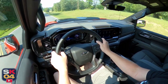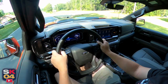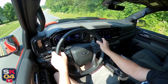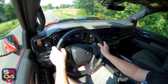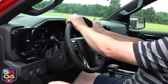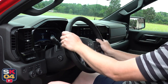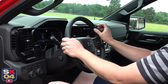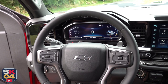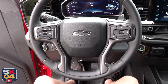The enhanced front and rear suspensions also incorporate lightweight components, such as composite second-stage leaf springs. The general suspension design includes an independent front setup and a solid axle setup in the rear with semi-elliptic variable rate multi-leaf springs. The steering is an electric power-assisted rack and pinion setup that offers good feel, surprisingly responsive behavior, and easy maneuverability for such a large truck. The steering has been further tuned for the mud terrain tires to compensate for the extra resistance of the more aggressive treads.